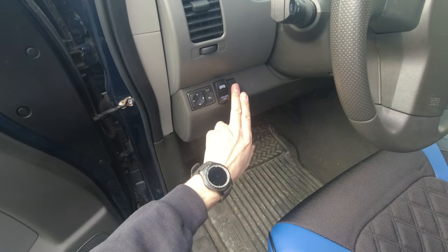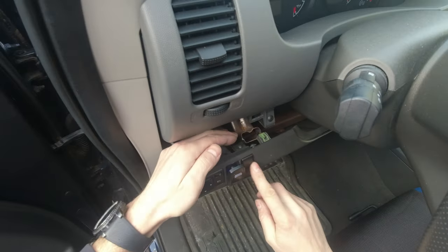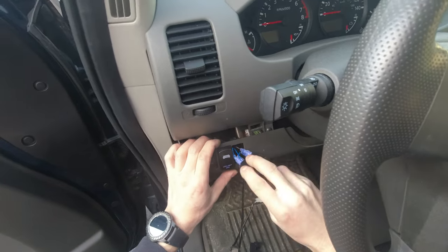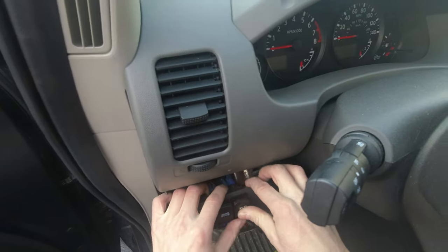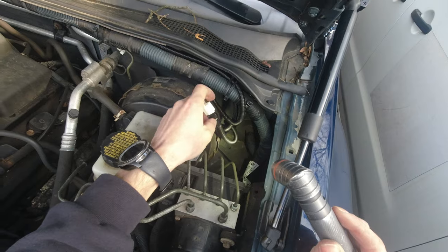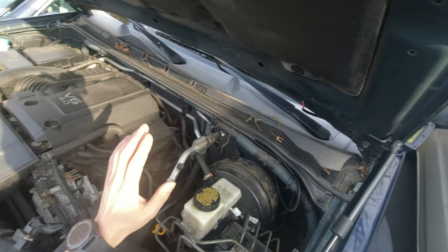Let's continue. We're just gonna remove all of this and install our new light switch over here. Pull this part out, unscrew one bolt over here, and then just gently pry this thing down. Now we remove this blank. We're probably gonna have to file this because it's not gonna fit. Let's get our switch and try it out. It's still a little bit too tight so let's file a little bit more. Beautiful. So now let's just put everything back in place. I used the same wire loom to wrap around the cable and brought it to the same firewall location. So this is my switch wire over here.